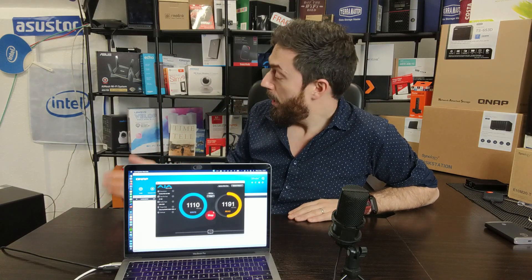Other things about this device: we've done our Plex testing and it is still to date the highest performing desktop Plex media server we've reviewed here on the channel and on the blog. It does arrive at a price tag — realistically two to two and a half grand depending on memory configuration — but it's always going to be that six-core Xeon W1250 processor. Right now this is very much the score to beat — it's got ZFS on board, dual 10GbE, optional Thunderbolt. It's the go-to device currently, and if it had been released a month sooner it probably would have made our best-of-the-year articles.